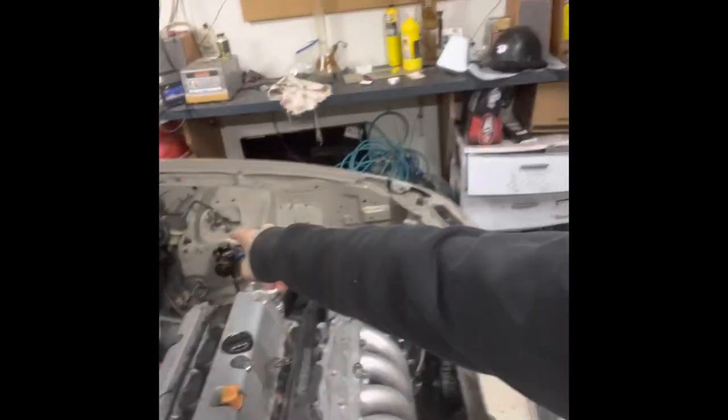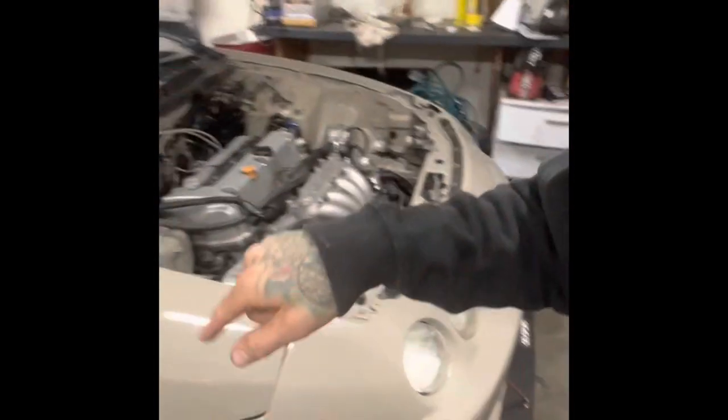And if you swapped the lines at the master, let me back up. Those two wheels were locked up, so I went to go bleed them, and one side wouldn't release any pressure, but the other side would. So I swapped my lines at the brake master, and the issue traded places. It swapped sides. So after that, I was like, forget this, I'm going to get a new brake master. Kind of narrowed it down, and I thought really that was the only thing it could have been.